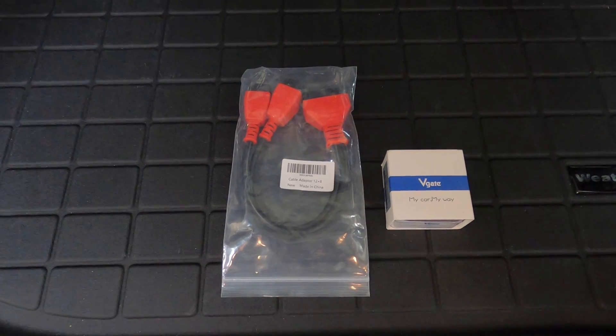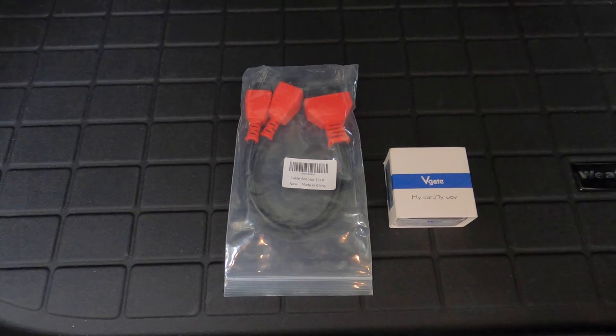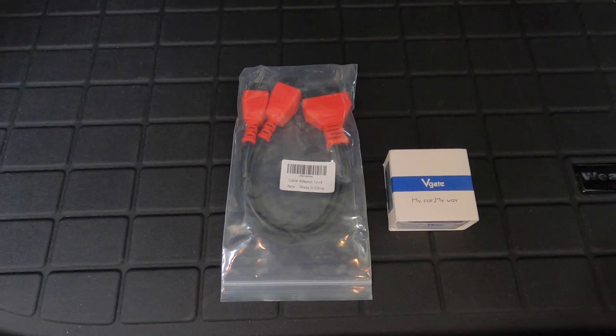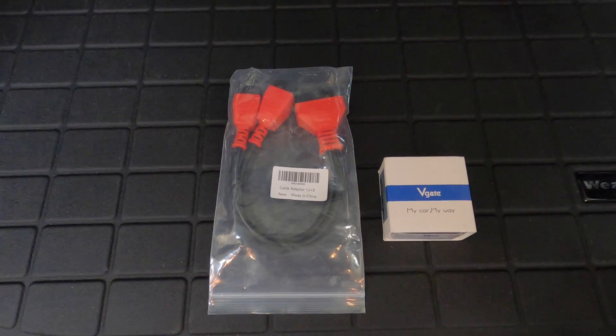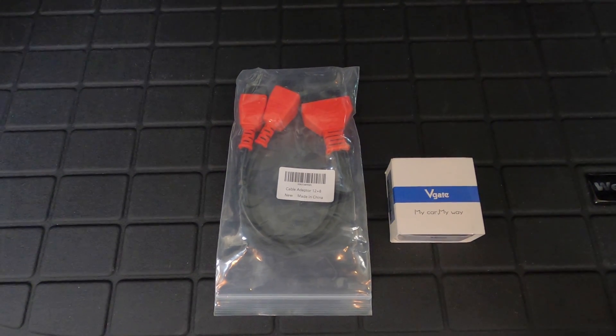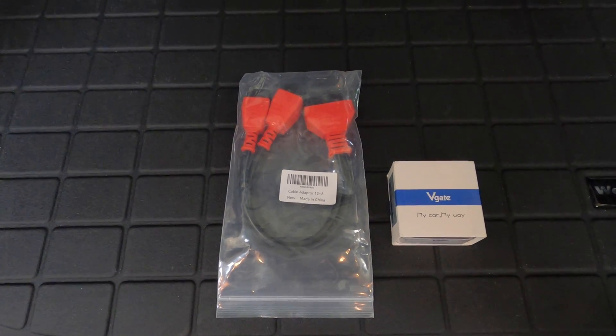To get started - the flickering is usually caused because this vehicle has a CAN bus system and the LEDs are confusing the car because they require much less power than the standard halogen bulbs. The computer is trying to send power, it's receiving back the wrong signals and it's just confusing everything, so that's what results in this annoying flickering. There are a couple of ways to solve that problem - you can use resistors, you can get a CAN bus adapter or similar depending on the issue.